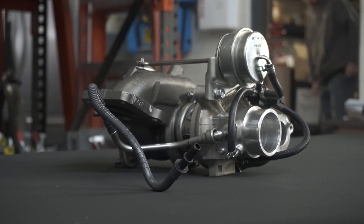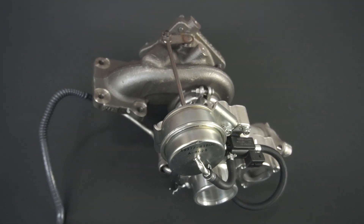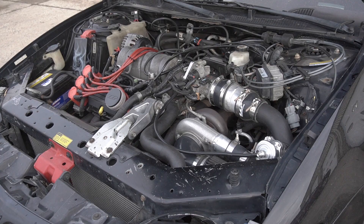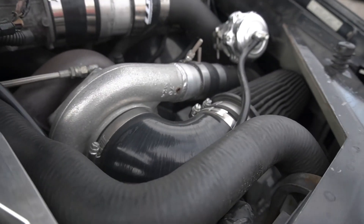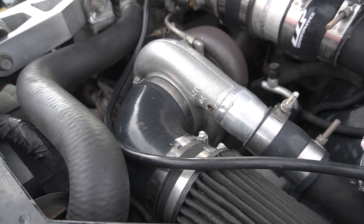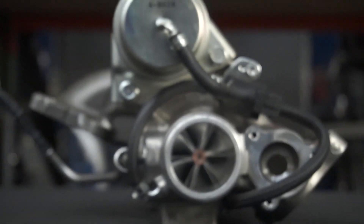However, the gains also show this. Turbochargers in modern day are just more efficient than blowers. A blower also takes power to make power, whereas a turbo uses exhaust gas efficiently. Especially on the 3800, which is a good displacement size engine, it's not going to have much turbo lag. A lot of guys have an old mindset that turbos are laggy or not efficient, but that's not true anymore. Most turbo setups will make more average power and come on boost just as quick as a supercharger setup. It's all about selecting the proper size turbo.